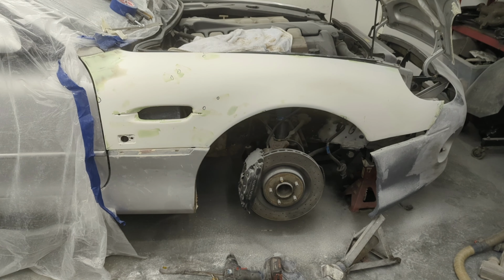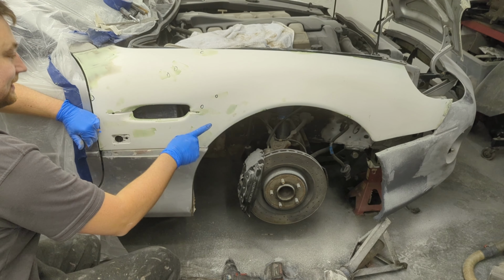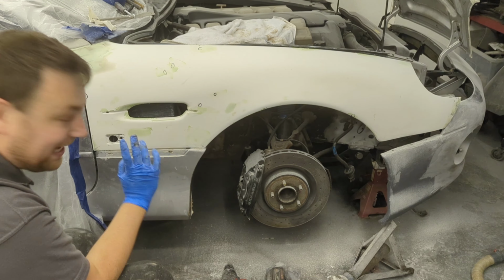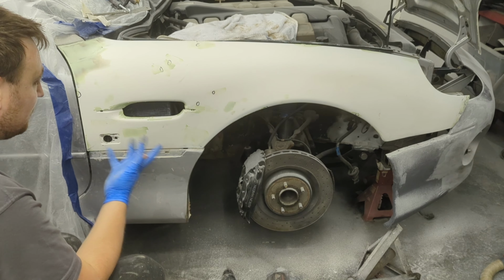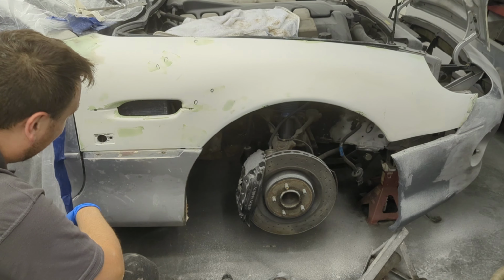Perfect. So what I've done, I've just gone around the whole wing to look for any little minor imperfections, and I put a little bit of dolphin glaze in. So you see I've done all the little circles. I've just filled all them in, I've put a little bit more here. I'm trying to make it absolutely perfect, so I spend a lot of time on this. If I'm honest, on a lot of other cars, I probably wouldn't have spent this amount of time, but because it's an Aston Martin, I want it to look perfect. So yeah, once this has gone off, which it nearly has, I can give it a bit of a sand